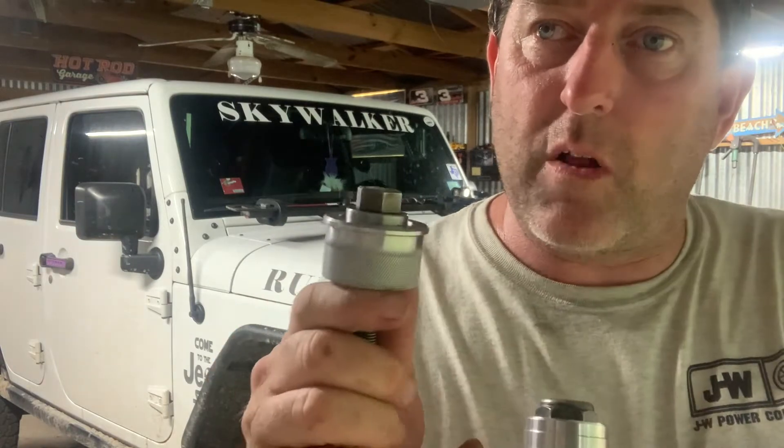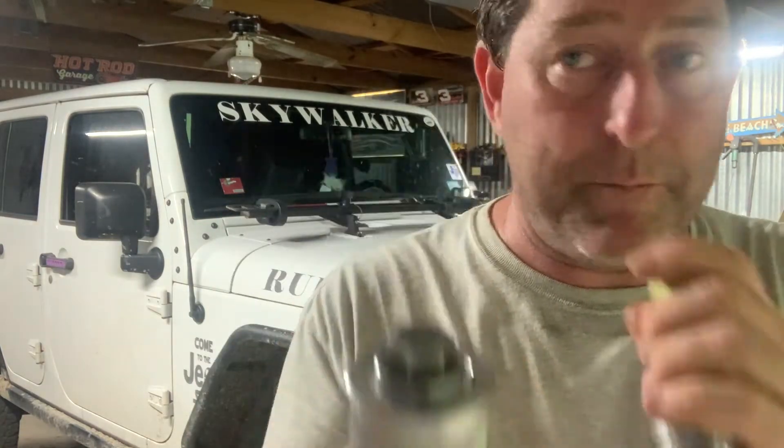Top: thin shoulder, in from the top. Bottom: thick shoulder, in from the bottom. What these do is they replace the old-fashioned ball and socket ball joint, which is kind of prone to failure on Jeeps. Not really a problem with the ball and socket design — it's really our own fault because we as Jeep owners can't leave things well enough alone and we all have to run huge tires. These have a spherical bearing — it's not a ball and socket design. The spherical bearing takes the load way better. They are tough and should last quite some time.